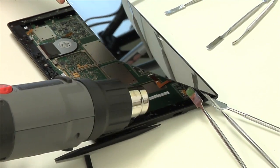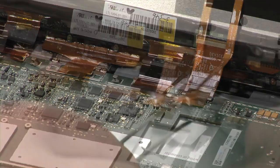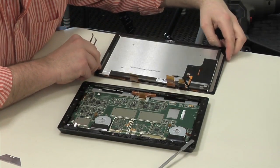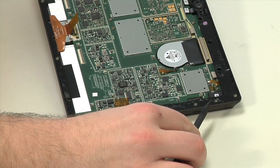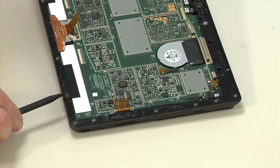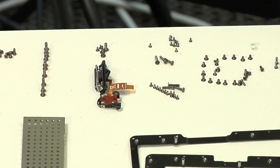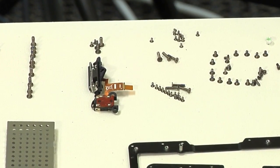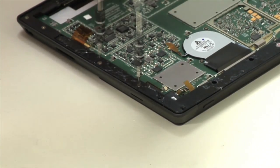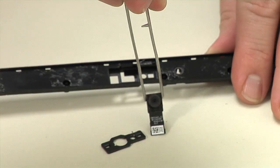Removing the front panel is a slow, tedious process. But if you rush, you risk damaging the tablet. After disconnecting all its cables, you can set the front panel and LCD assembly aside and begin removing the internal components. Like the RT, the Surface Pro is filled with screws, ranging in size from Torx T2 to T5. I recommend cataloging the location of the screws as you remove them.